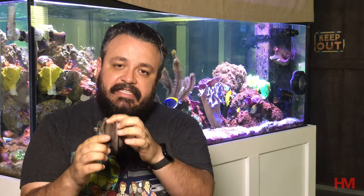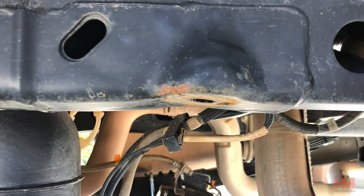Number three: bump stops. The stock bump stops that come on the Raptor are kind of a joke. This thing's not going to prevent any damage — it only compresses about an inch and I've destroyed mine. As you can see, mine are pretty bent up. And where this one was actually installed, my actual frame was bent because this thing didn't do much. So you're going to need more protection if you plan to off-road your truck.